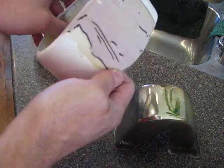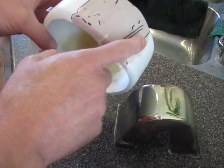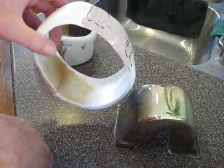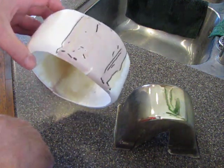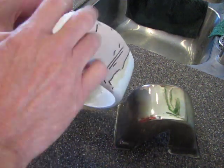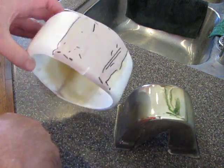Where this has the fiberglass on the inside, I put fiberglass on the exterior first layer and then Bondo on top. I don't know if that's a no-no that you're not supposed to do, but I haven't heard anything about it. It's just a preference for sanding — it's easier to sand the Bondo down than the fiberglass, but the fiberglass gives it a stronger bond.